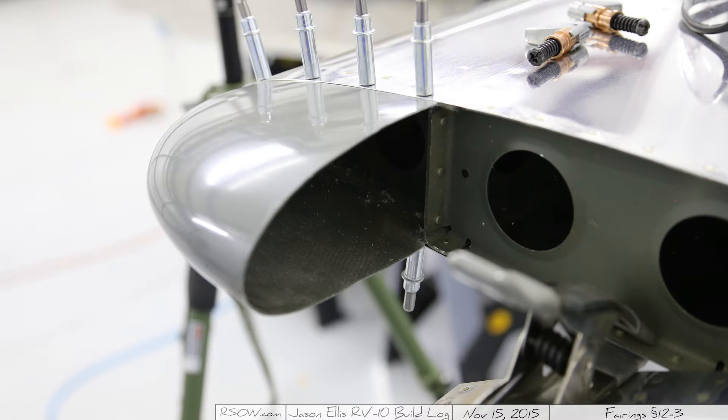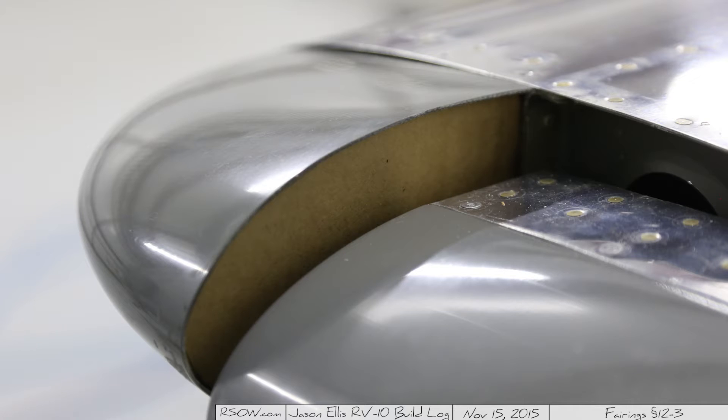The right shape being of course the inside of this fairing tip — that opening you see there has got to be closed off. My first attempt was just to use a piece of cardboard, but I found the cardboard kind of crushes over time, so I went with foam. It also crushes but it's not quite as bad, and I find that cardboard and foam work together very nicely. However, they don't take into account the fact that the fiberglass piece itself has to be cut a little bit in order to make the dog leg shape.